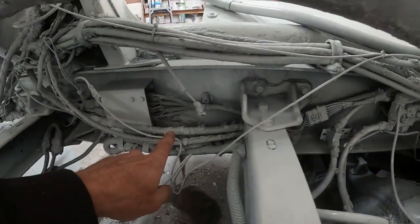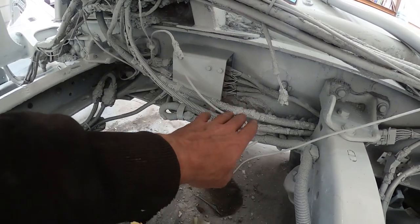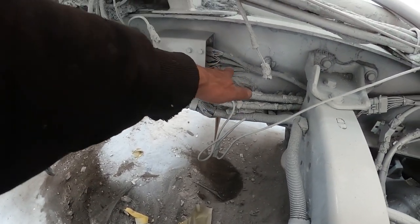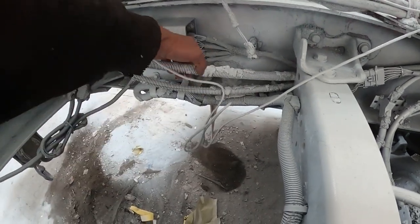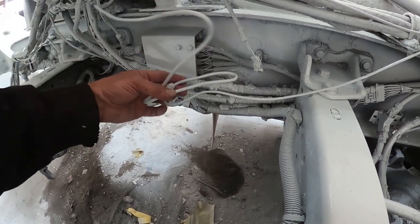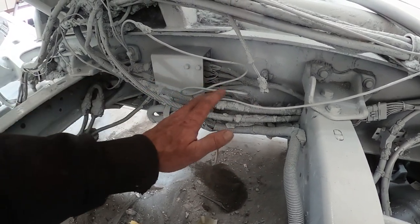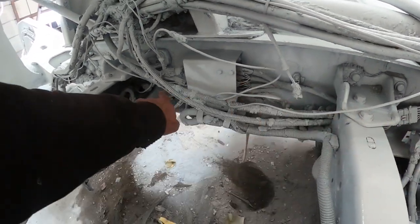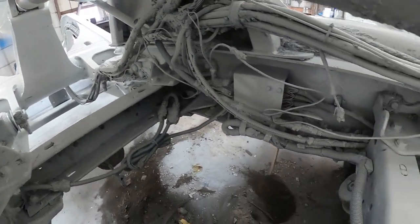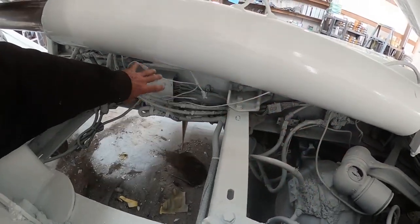Look at all that concrete left behind — how sloppy is that? Well, I do that on purpose. If I got in there and blasted out all of that concrete — that's like two or three inches thick right there where I'm pointing — all this wire loom, which is what this coating is called, and the wiring and the vacuum lines and the air lines, everything that runs through here would get bared and eventually eaten in two. I would essentially destroy their truck if I got in there and tried to remove all of this from the chassis. So I don't. I don't bother with it — it doesn't hurt anything, it just is what it is. So I abrade it with a sandblaster, make sure it's going to hold paint everywhere else, and then I just paint them. This is going to have more concrete on it within a week.